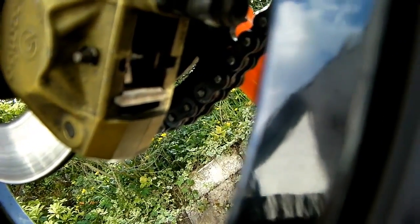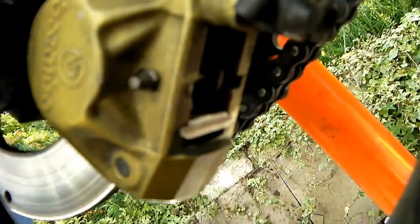One thing I forgot to mention — the anti-rattle spring has a direction arrow on it. It's not glaringly obvious even once cleaned up, but when I checked, I realised I'd fitted it and it didn't look quite right. It has a direction arrow which goes in the direction of rotation of the disc, meaning the bit that sits outside the caliper goes opposite the bleed nipple and the feed banjo bolt.